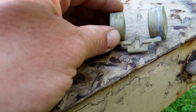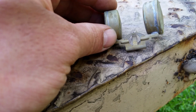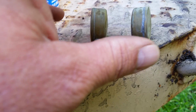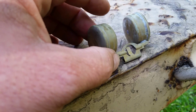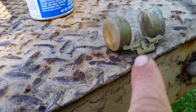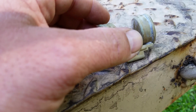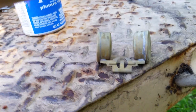If you look at it and both floats are level on the table, and there's a gap underneath your needle, you're not going to be able to adjust this float properly. So then you'd have to go ahead and finagle the float a little bit to manipulate to get it back to the point where it sits flat. And I see this a lot, very uncommonly detected. And then they're like, oh, okay, well, now I'm not getting enough fuel, but I adjusted my float. I've done it like 4 times. How come I cannot get a proper float adjustment?